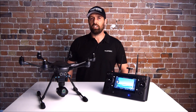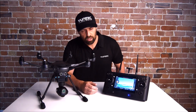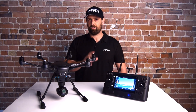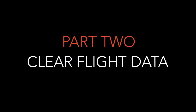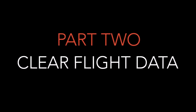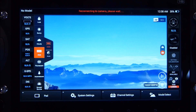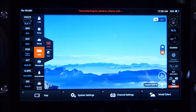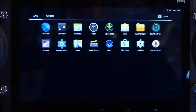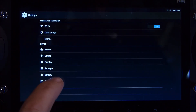When the ST16 has finished its update, it will reboot and you might notice the screen is a little bit different. The next point is really important: you need to clear the data from the ST16. Once the update has happened, you need to select your language — I'm going to select English. Then go into the pad, into Applications, into Settings, and click on Apps.